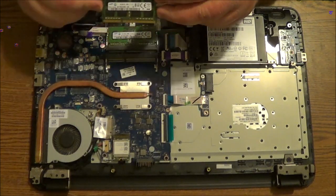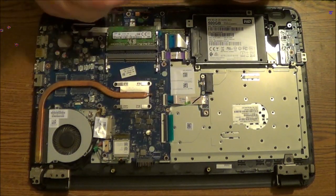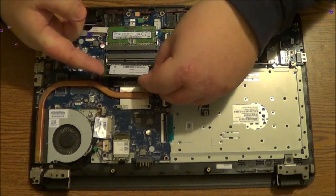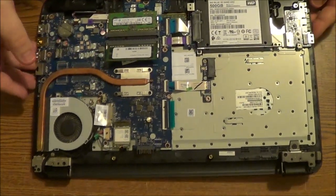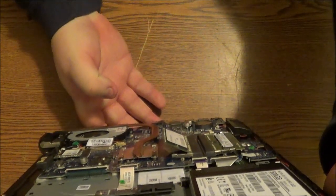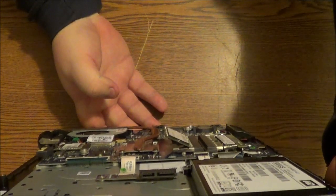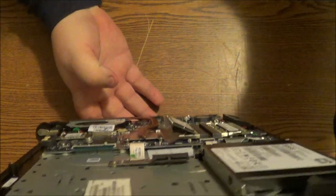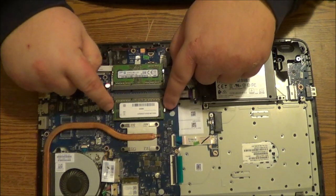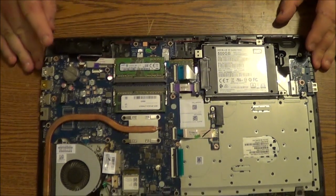So what you'll do is, on the other side, take note as to which ones they use. Simply put it at a 45-degree angle, like so. You'll see how I have it at a 45-degree angle — that's what you want. And then you can gently push down on it so it can lock into place. Gently push it down and you'll see the claws grab a hold of it and lock it into place. And that is how you change or upgrade the memory.